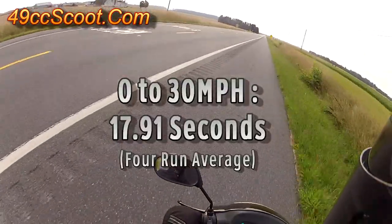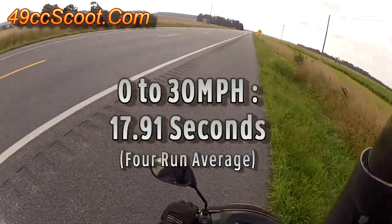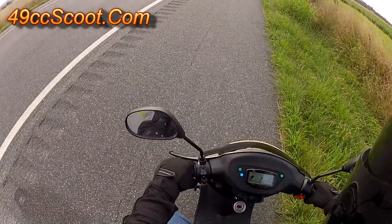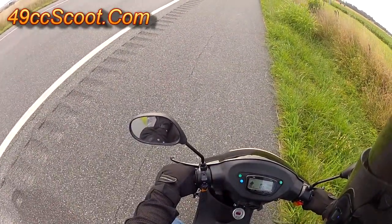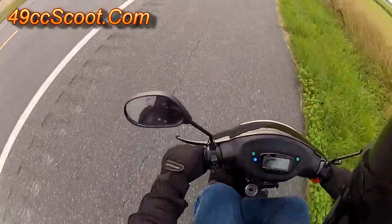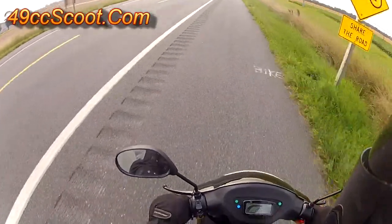More than a half second quicker to 30, which I attribute to improvement in throttle response on starts. I can feel the difference at every stop sign and each time I get back on the gas. I think the increase in fuel economy happens for the same reason. It was just too rich without the adjustable needle. The Keihin is a worthwhile swap and a good carburetor, but I think you could probably see very similar results with a stock carb using a different needle.